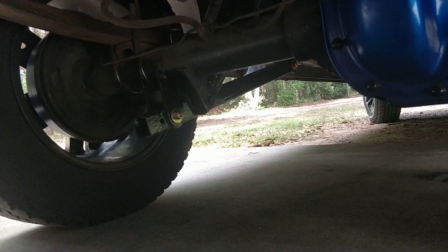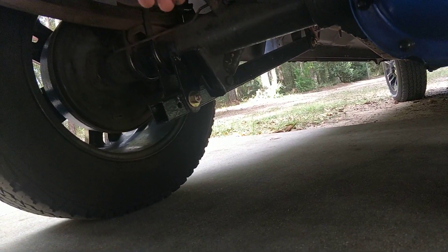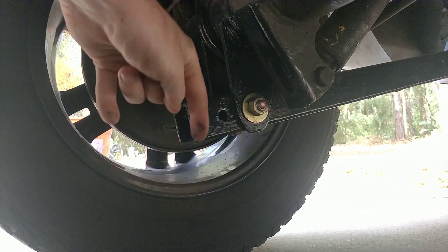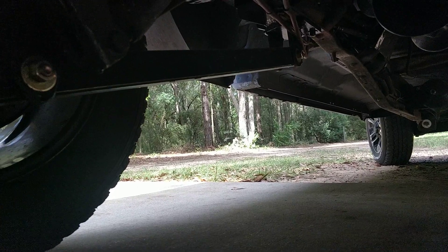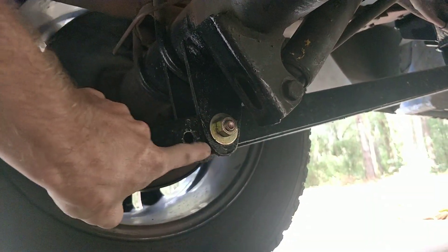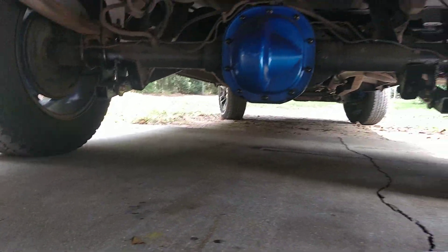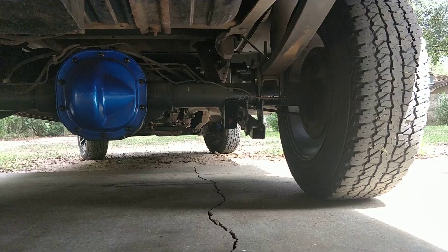Hey, on the hole — there's two holes there because I drilled it in the wrong spot in the first place because I didn't measure right. It's a good inch and a half off because I measured it from the back side of the axle. What I should have done is taken a piece of string with a fishing weight — the pyramid weights — dropped it over the back of the axle, and measured from that up to where I wanted the bolt. I forgot to take an inch and a half off because this is three inch tubing. It works though — no wheel hop. Run 15 pounds on tires all day, every day. I need to get some fatter tires and lower it even further.